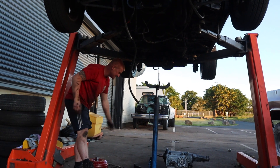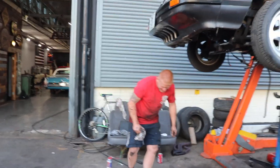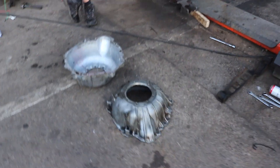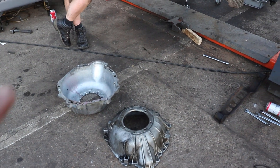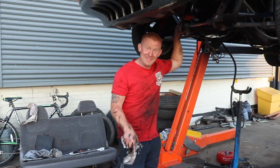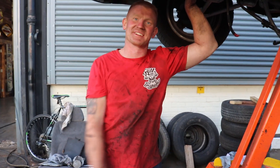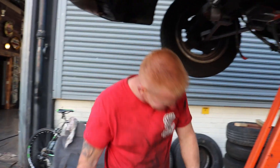We're not defeated — we're Spotted Motors! So a matter of minutes since we last spoke and we've got two bellhousings. The bellhousing that I've bought is for a smaller flex plate, so it doesn't actually go with Dale's flex plate. So we're going to put the gearbox we just took out back in with our original bellhousing, and we're getting the prop shaft shortened to suit the car. Let's bolt that back on and put the gearbox back in.